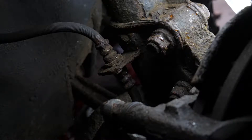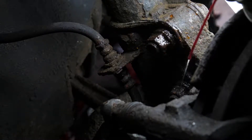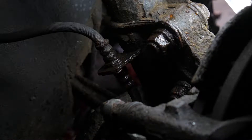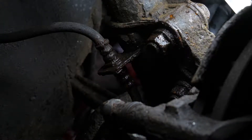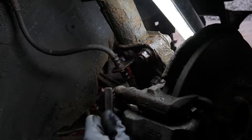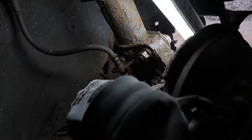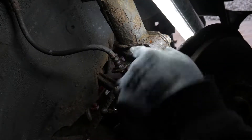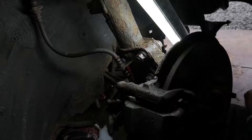The best thing to do right now would be to spray every single component you could be working on with some kind of penetrating oil. Spray the anti-roll bar link. It gives it a chance to soak. Whilst you're here, around the back you'll have your tie rod — wire brush that as well, because it helps when they come to do your alignment. Also give the brake bleeder a good wire brushing and loads of penetrating oil, so when you come to bleed the brakes later you'll have it half ready.